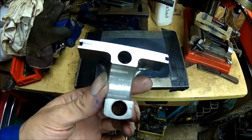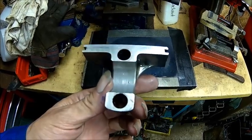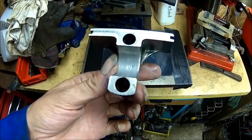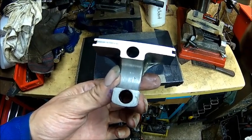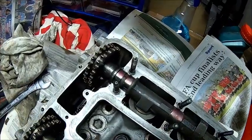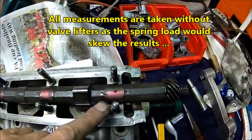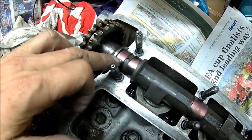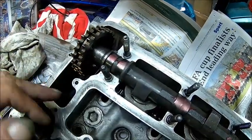We pulled the exhaust ones as well. I'm thinking it was a belt sander — just hold it down on the belt sander until you got the right clearance. The surface is extremely rough and I don't like that. We'll see what comes out of the measurements — we do some Plastigage measurements on the exhaust cam as well. That's how the exhaust cam looks after doing a little bit of work on the covers, because they were completely trashed. We have a little bit of low clearance here, but the journal diameter is smaller here than there, so that's the cap — there's nothing you can do.